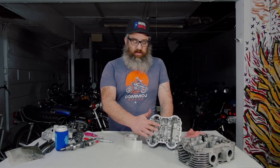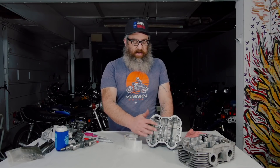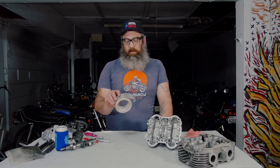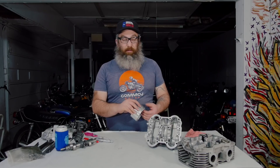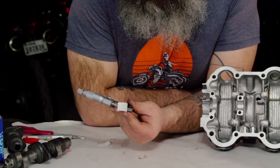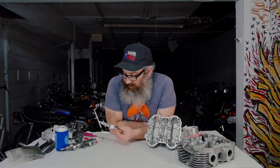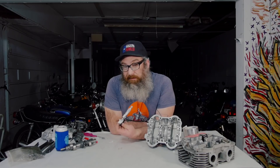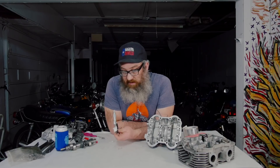The second technique, if you don't want to use the three-bond method, is to shim up the two pillars next to the center cam journal. What I use to shim it with is aluminum tape used in HVAC work — a couple of layers goes a long way. We're going to measure a piece to show you exactly how thick it is. A single layer of the aluminum tape is a little bit over three thousandths of an inch — about three-point-two. So if you put two layers on, you're going to get a little bit over six thousandths, maybe six and a half thousandths of clearance. By the time it squishes down it's probably going to be closer to six. But that's a little bit of extra clearance so oil can get in there and keep the camshaft and journal lubricated.